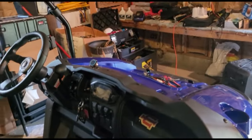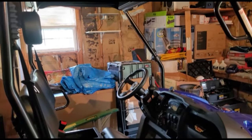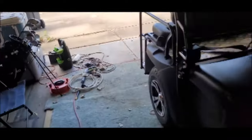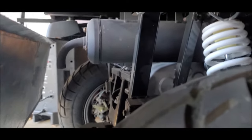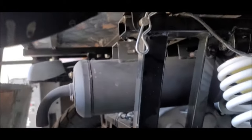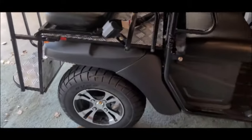So that's an overview of taking it apart — a little bit about the speaker install and all that stuff. I'm going to fire this thing up and take it for a drive to show you how loud it is. You can see it's all back together now. I'll point out those pins — it's actually a lot easier to take off than put back on. There's one pin, the hooks go around, then the pin that goes into the hitch area, and a mirrored pin on the other side. It's a pain by yourself but definitely doable.